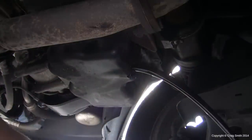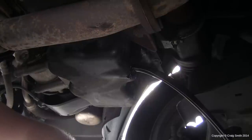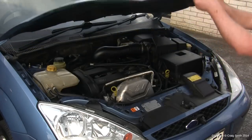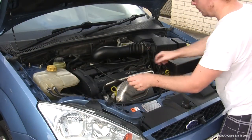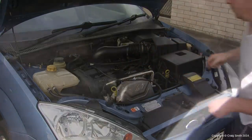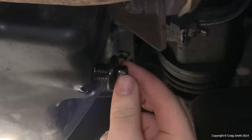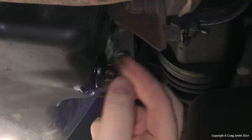Get the drain plug off — the oil is obviously going to come out. At this point it would be ideal if the oil was a little bit warm, because it's just going to drain from the engine that much better and you'll get that last little bit out. Whereas if it's completely cold, you won't get quite as much out. So once it's draining, get out from under the car and open the bonnet and remove the oil fill cap from the top of the engine. Then you just need to wait until it's finished draining. Once it's mostly done, get under the car and just put the drain plug back in, just finger tight — we just want to stop it dripping all over us while we remove the filter, which is the next stage.